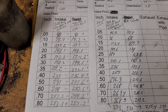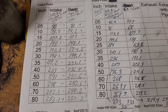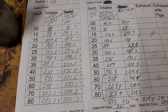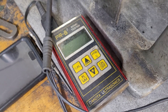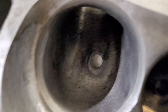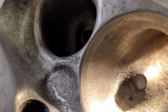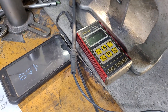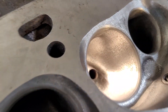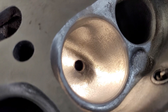Which is still going to be a pretty damn good head. It has a very good exhaust port, and I did do a little more research - they do come with larger intakes and exhausts, so I didn't do that much work to these, they are that big to begin with. Another thing I should mention is my sonic checker is a great tool, but let me show you how rough I had on these other ports. I had a really rough surface on that. When you have a really rough surface it's not always super accurate, so what I wound up doing is I went over and gave a smoother texture to the bowls and I was able to get a much more accurate measurement of how thick they are in spots.